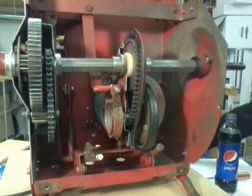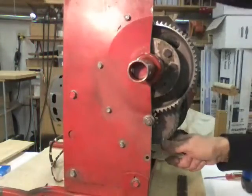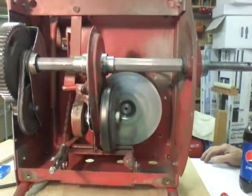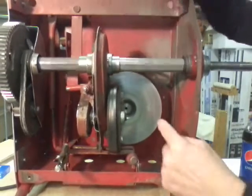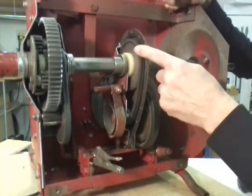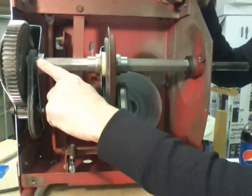I've got a foot pedal on here to turn this thing on and off. I'm going to start this up and put it in first gear - that's in first gear now. We'll step on the pedal. You can see that the hex shaft is turning - that's when the drive disc starts and the clutch disc is rubbing against it. That turns the lower sprocket, which turns the chain and the upper sprocket. The upper sprocket is hooked onto the hex shaft, so now you're turning that.